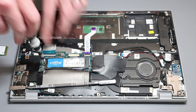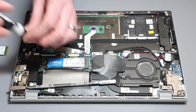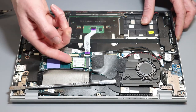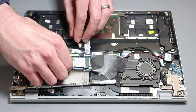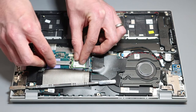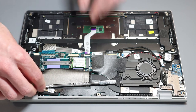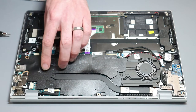As it is, I'm going to keep the original SSD in this machine. So we remove the 2280 shim and refit the 2230 — we simply slot it in, slot in the holder, and then screw it back into place with the retaining screw. With that done we can then just let the cover sit back over the drive.